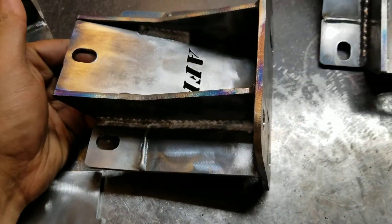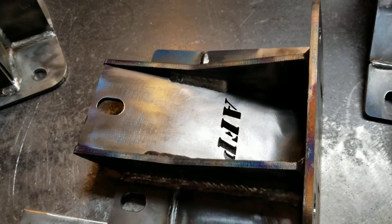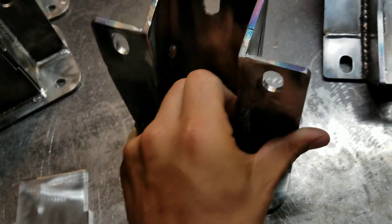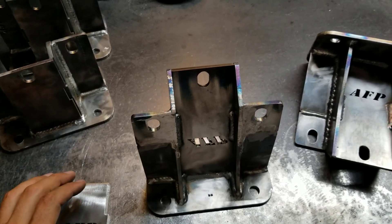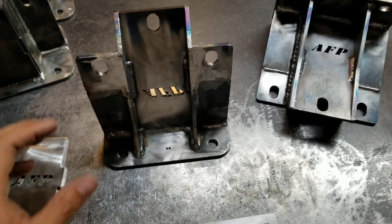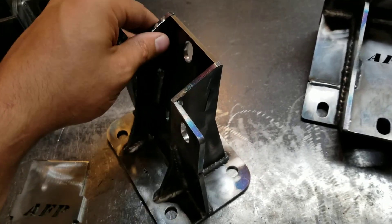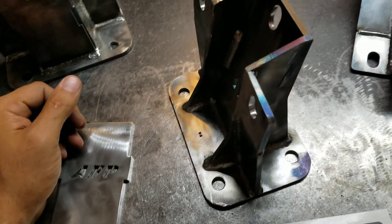These are guaranteed to never break. If you manage to break one of these, I will buy you lunch because you're doing something crazy and you're probably having a bad day. It's 3/16-inch steel — very strong. The stock motor mounts are fluid filled and they do have issues being weak; I know guys have replaced them every 100,000 miles or so, or even less than that in a performance application. I have guys running my mounts making 1,000-plus horsepower with no issues, which I wouldn't expect any being as overbuilt as these are. These are the last motor mounts you will ever need to buy for that truck.